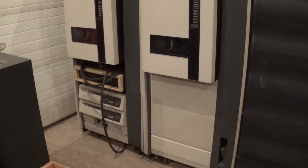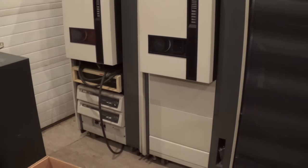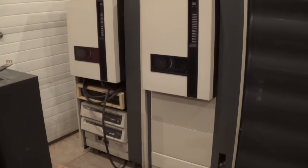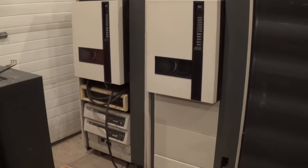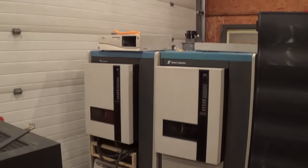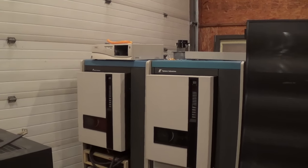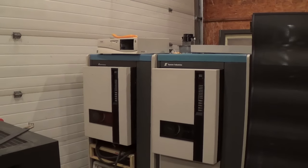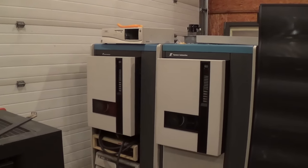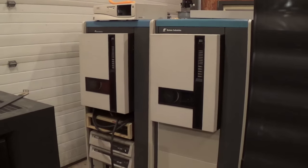There's another DDS drive system there in that sort of yellowy-beige box at the top that has a Winchester and an 8-inch floppy drive. These systems used to run very large Xerox laser printers. They were the COM heads. I picked these up this year. The crappy Compaq that sits on top has an incredibly unusually rare, not eBay rare, as in actually rare, StorageTek controller. So the PC can read and write to the tape drives, which is fabulous.